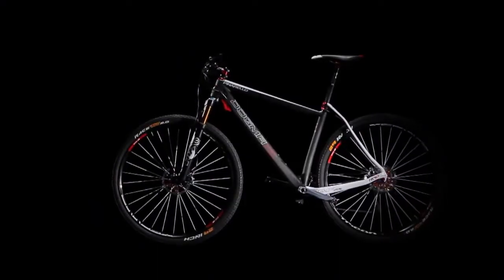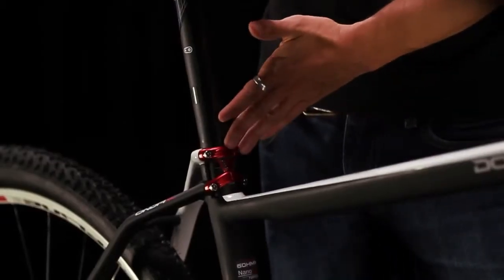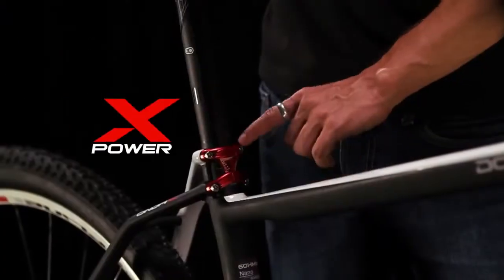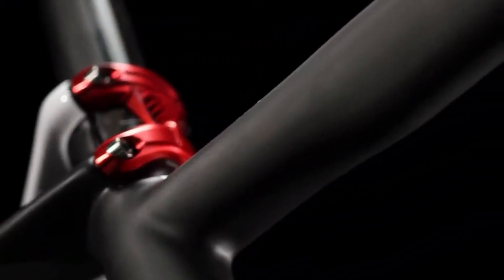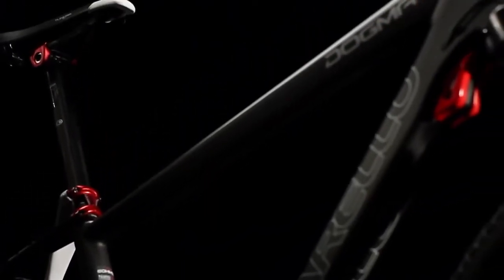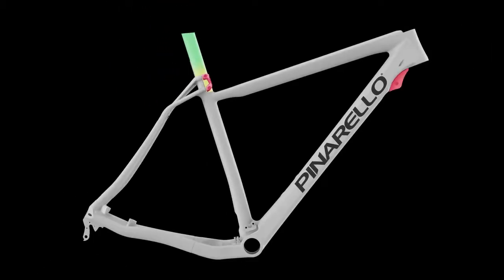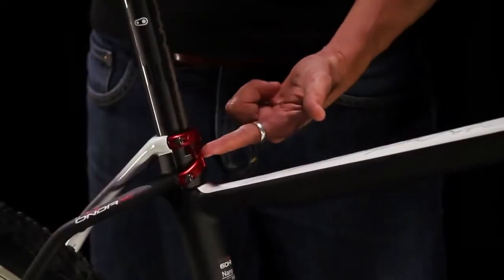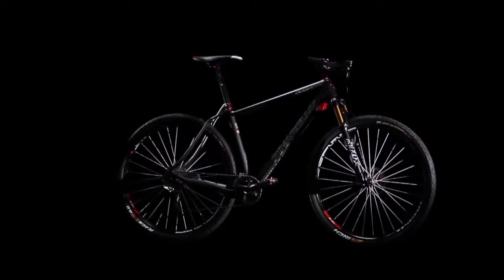We even looked at previously overlooked aspects of the MTB frame, such as the seat post clamp. The seat clamp has a revolutionary design with a new four-bolt construction directly mounted to the seat stays — we call this X-Power. This construction allows the seat clamp to close over a larger surface area, reducing by nearly fifty percent the stress normally concentrated in a critical area exposed to high levels of load and force. Safer, more efficient, and more effective.